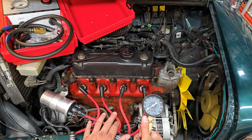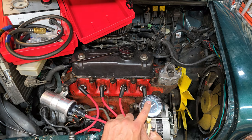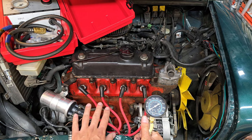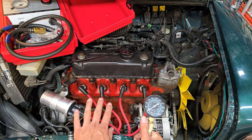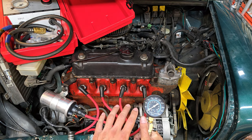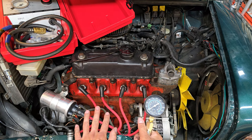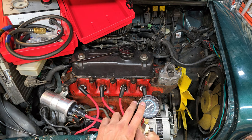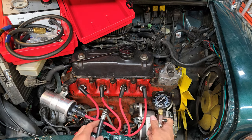That's not to say certain engines are not as healthy as others if they don't have the same pressure — it all depends on how the engine has been built. So if it's a high-compression cylinder head, it'll have higher numbers on the gauge than a standard compression cylinder head will. I don't know what the numbers are in this car, but if you see them all say 120 pounds across the board, then great — everything seems healthy, at least with building compression.